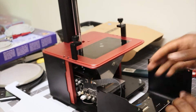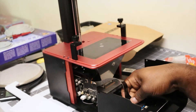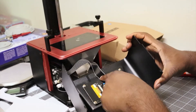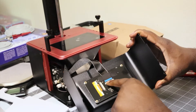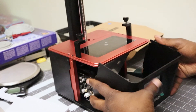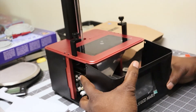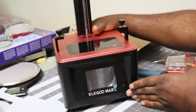So I'm basically doing everything in reverse order, making sure the LCD is right side up. I'm just going to slide the ribbon cable back into the connector — it's a little tricky because it wants to slide back out, so I kind of hold it in place with one hand while I slide the retention clip back into place. Once that is done I can reapply the tape since it's still sticky, and make sure it's not going anywhere before I put the front housing assembly back onto the machine. I'm lining it up — it's a little more tricky to get it back on since it is such a snug fit, at least on my machine. I have to bend the metal a little bit to get it to go back, but once it's on it slides right into place and all I have to do is replace the screws.